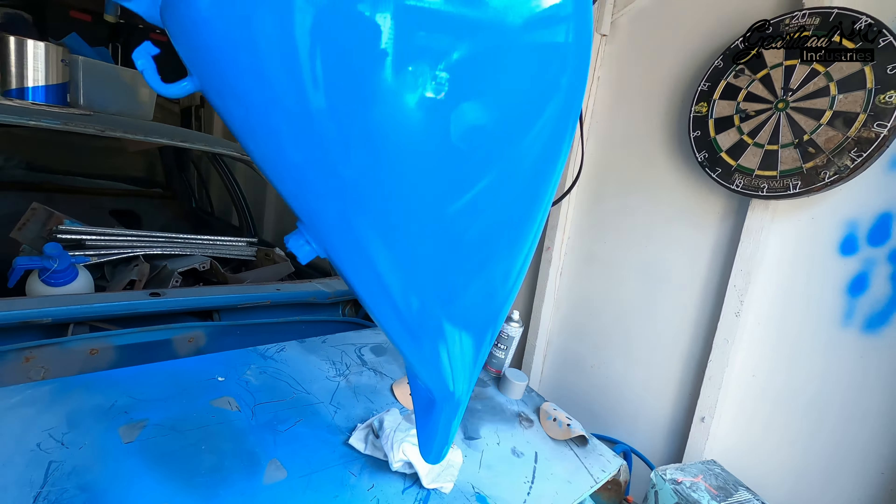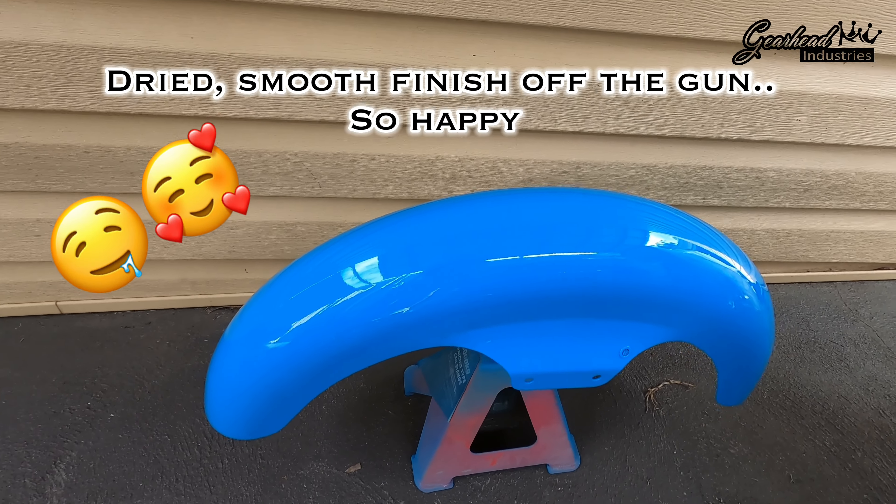You can see the repair came up pretty well. There's a couple of little pin holes in there from the filler, but that's alright, I can live with that. It's just more memories that I painted it. Overall it's going to be a very clean bike - it's going to polish up well, it's going to present well, so I'm happy with that. Super happy with that. That's the second coat - I'm going to do one more decent coat and I'm hoping that would do it. I want to get it up to that nice third coat, nice and heavy, try and leave it a little bit glassy, and then it should polish up well.